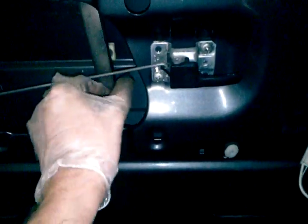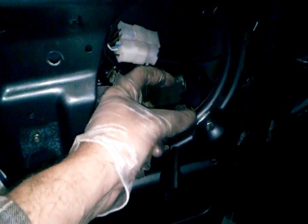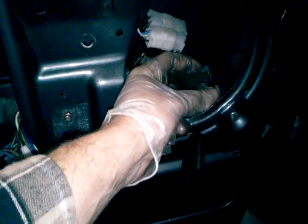Once you get that where you want it, you put your two bolts, one up here and one underneath, in place. I actually took this plate off of here, but you can put that back on pretty easily just to keep that from jamming stuff up. All right, then you keep sliding your motor across this way. Now you can see what I did. I've actually spaced the motor back into the door quite a bit. It's in here behind the panel about that far. So that's plenty of room for your speaker to go in here and not actually hit the motor.